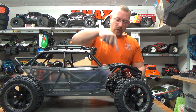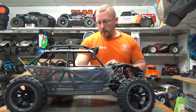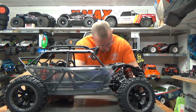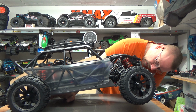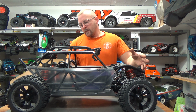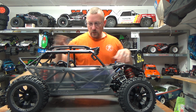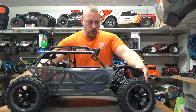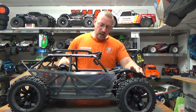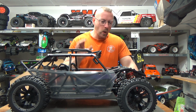You also have way more suspension travel in front and rear. The chassis is higher in the front than in the rear, but you cannot go higher in the rear. You're at the maximum point, and you cannot adjust the front. They have no screw to put the front a little bit down, and the fact is that at its maximum point you cannot easily drive a truck that way because it will be bumpy. You need, when all is in the truck, to go 20-30% down, so you have a cool laying down truck. And when you do it, you will see the ride height is low, but in that big scale it will maybe be plenty.